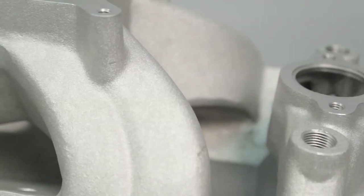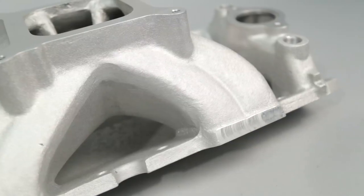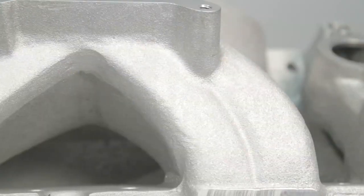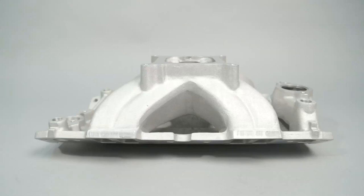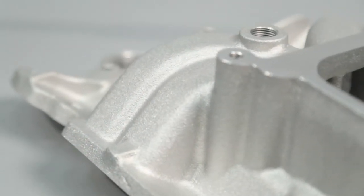However, people don't understand that when you get to a common V8 configuration with a central mounted throttle body, you have long runners on the outboard cylinders and short runners on the inboard cylinders. Therefore you've really got two different engine configurations. Every V8 engine is really a combination of eight engines put together. Those four outboard cylinders have different needs than the four inboard cylinders, and addressing that issue was the genesis of the four pattern camshafts.